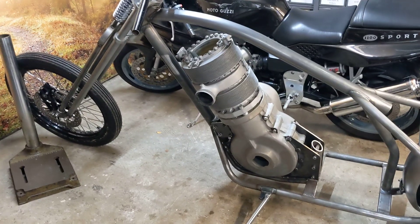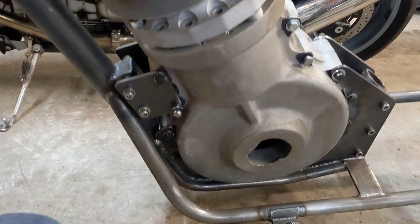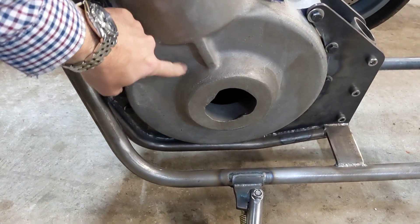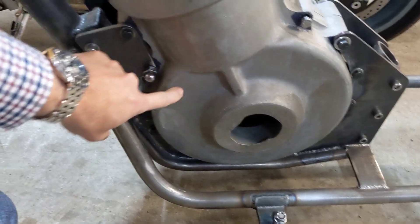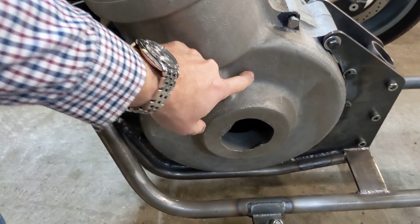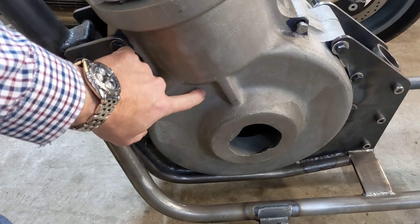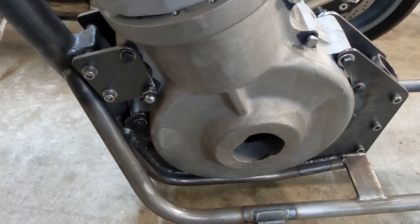Here's the bike, and as you can see, I found a use for the short stand for the old pillar drill. Although the engine is leaning forward, there isn't really much height difference between here and here — perhaps maybe an inch total. If I'm going to run a hose from here to the oil tank, which will be at the front of the bike, I think it's nicer to have a shorter run for the hose and not have to bring it over the top of this rib. So I'm going to locate the breather on this side of the rib rather than that side.